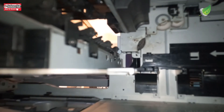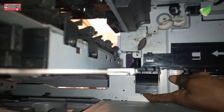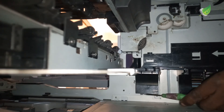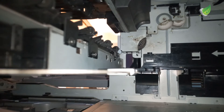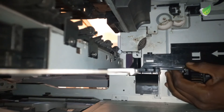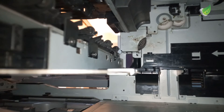I'll show you how to fix the problem on the printer. This is the side where the gear is — you can see the white gears there. Something is wrong with this plastic: this leg is supposed to be tucked inside, but it's outside, just like the second one. The other parts are tucked inside but this one is tucked outside. So because of this, the fuser unit is not able to reach the gears on the printer, and the gear on the fuser unit cannot engage with these white gears because this plastic is not tucked in properly — it is tilting downward.